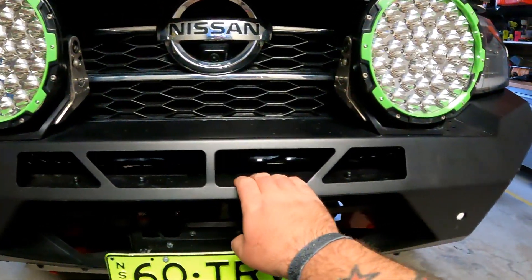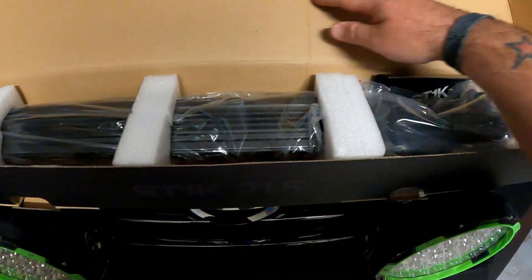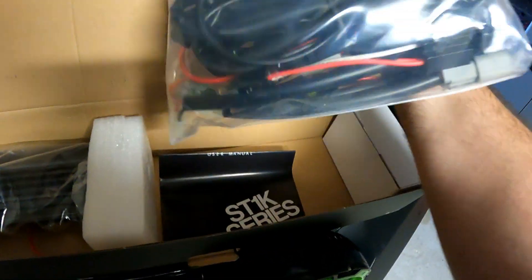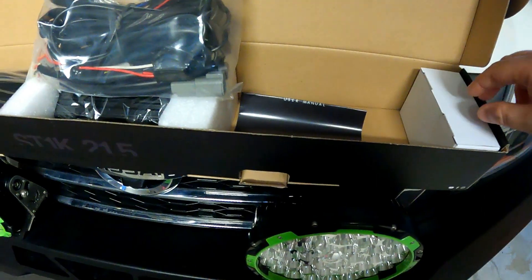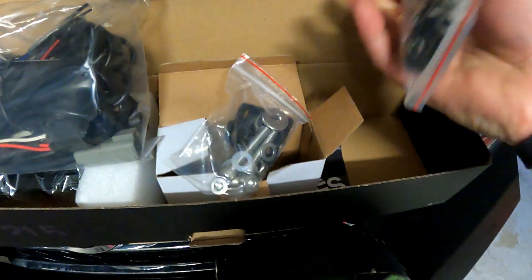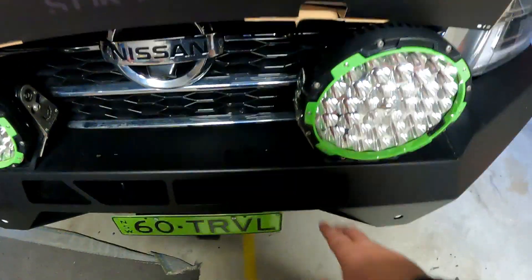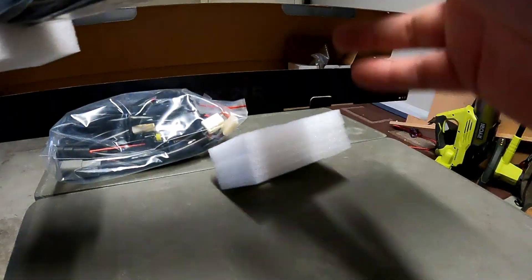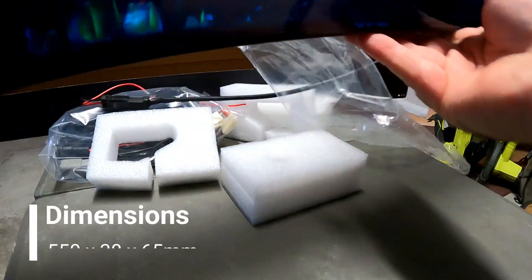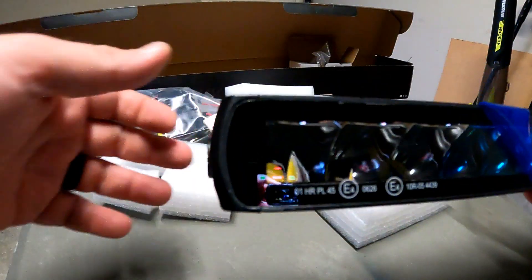For me though, the main reason is just to fill this gap. We'll get it mounted up and we'll have a look. Now, the good thing with a Steady light bar is it comes with a wiring harness. I also have a vehicle-specific switch for it. Box has hardware, N brackets and also slide brackets. I'm going to be using the N brackets because the bull bar — the Off-Road Animal bar — already has slots in it. So it is a 21.5 inch light bar. I'll get the lens on top of it, but it is super slim. It's got the protective coating over the light at the start.